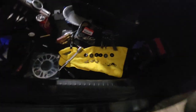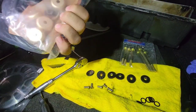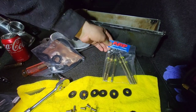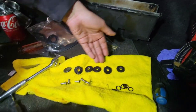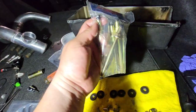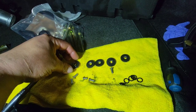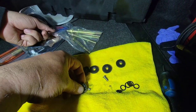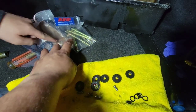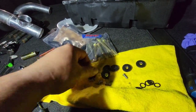So what do we recommend? We got the part number for the valve cover gasket with the valve cover seats, brand new ARP valve cover cam cap studs for the valve cover with some nice bolts. These are the bolts holding down the valve cover, and these are the ones holding the cam caps — those lock down on the cam caps. You're going to use the OEM ones, going back to OEM style — way better. Stick with OEM, go with ARP for the low-profile ones.